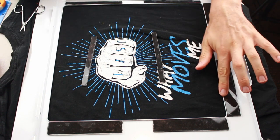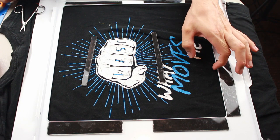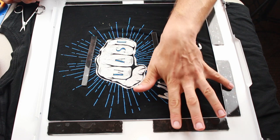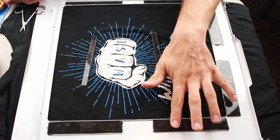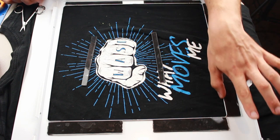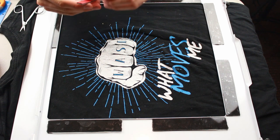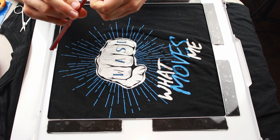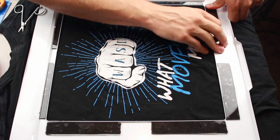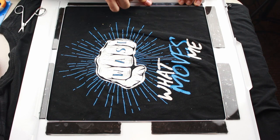And I can actually feel right here, it's about level with the door itself, maybe slightly raised, so that when we put the window down and we put the acrylic adhesive, it should sit very flush with the inside. Flush! It's not just something you do to a toilet. This will allow us to get secure attachment in all four corners. This is what's going to hold the window and the rest of the assembly up, so we need to make sure that this is very secure.